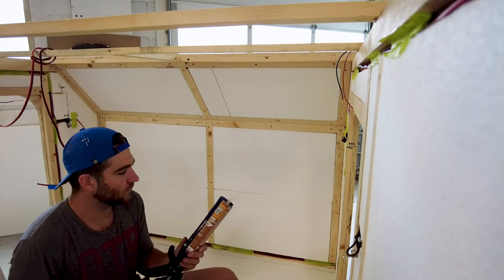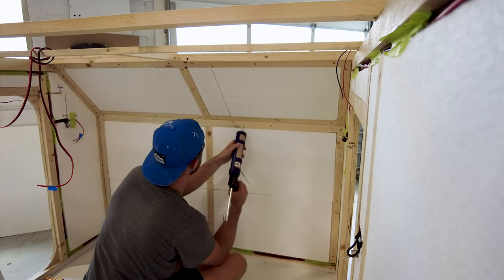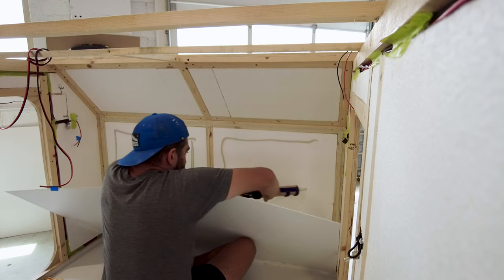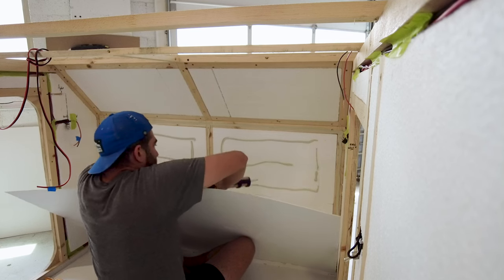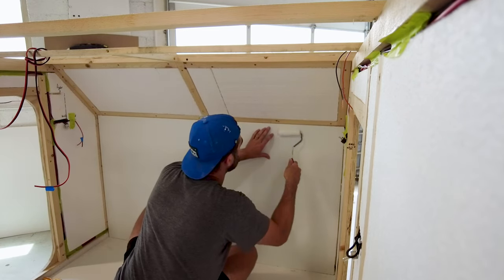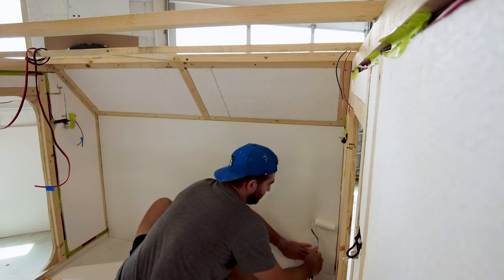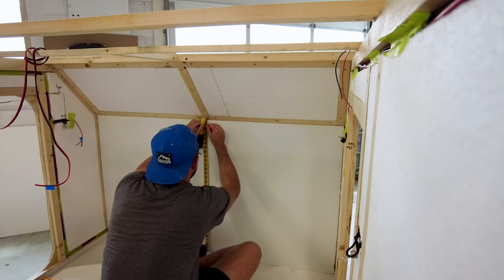To install the panel, I first put down a good layer of construction glue on each wooden support and along each panel of insulation. I used the cheapest bottle of liquid nails that I could find. After pressing the panel into place, I use a small, firm paint roller to push the panel into the glue and make sure that it is tight against the wooden supports.